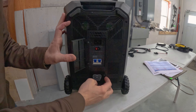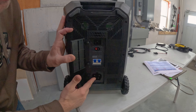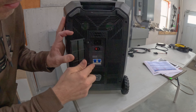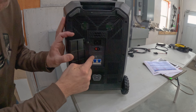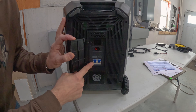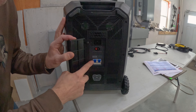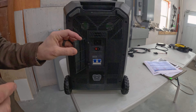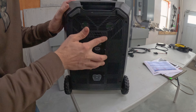On the back side of the unit you have your spare battery port, a fast charge EV charger port, your power plug-in, and your solar connector. One other big advantage over the Delta Pros is the circuit breakers — it has an AC-in circuit breaker and an AC-out circuit breaker. The Delta Pros did not have this feature, and I believe if it had them I probably wouldn't have fried my Delta Pro unit. This is a nice safety feature to help protect the unit and prevent a fire; when my Delta Pro was smoking, it likely would have burst into flames if I hadn't been present.